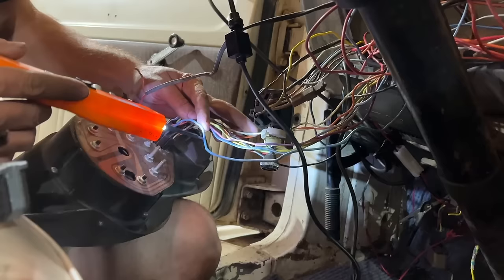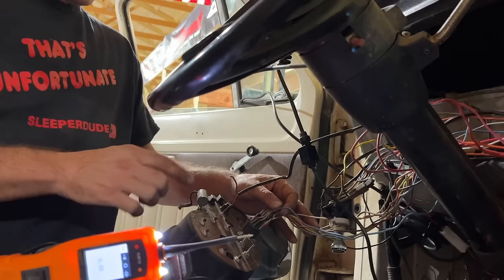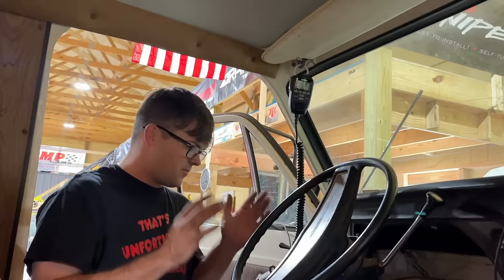So we reconnected this blue wire to the fuel send unit, which is the ground side of the deal. I realized I did not have a power side of this gauge. After messing with this, I figured out we didn't have power coming into this. Since that's the only gauge in the factory stuff that we're using, I just hooked a new power wire straight to it, instead of running through all these other things. So with power ran straight to it, we now have a fuel gauge that works. We've literally been down here like half a day or more messing with this. It's just me digging and checking and finding stuff, but we now have a working fuel gauge and brake lights and tail lights and blinkers, so that's good.